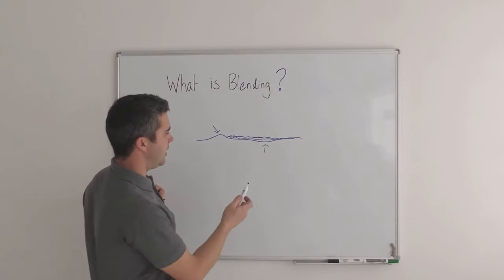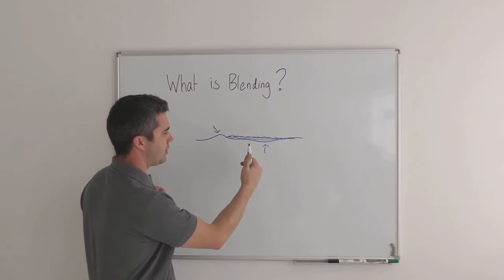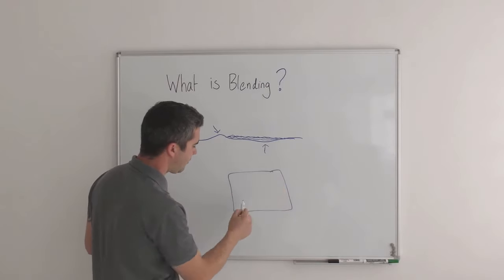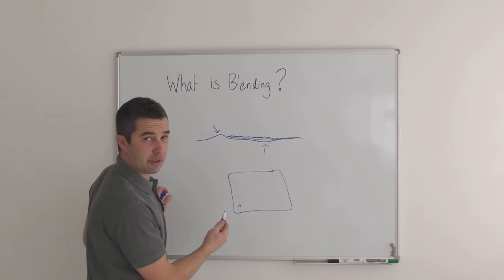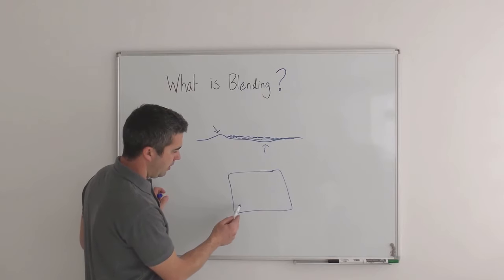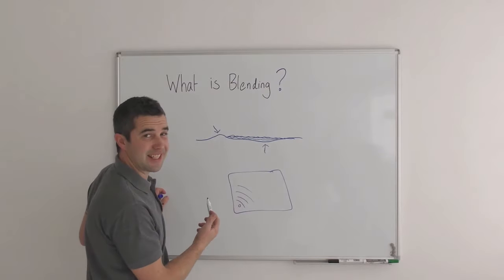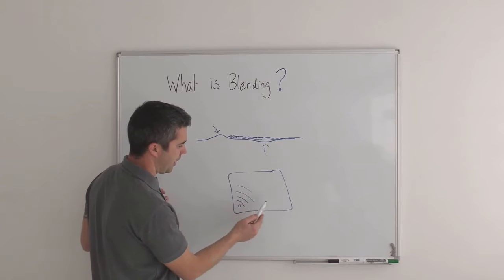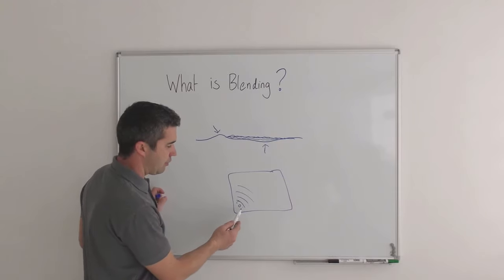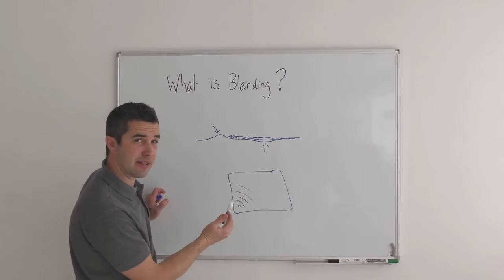What's really good about blending is you're working on more than one low at a time. If you're looking down onto the panel - an aerial view - here's our dent. This is roughly what I was doing on the roof of the Renault Clio: we had a dent here that I'm blending, but as you're tapping you are getting slight ripples - even though you can't see them - that go across the panel. So you can have a low spot just outside the dent area and those same ripples and that waveform are going to send energy across and start to lift those lows a little bit.